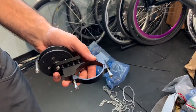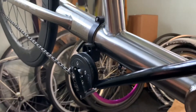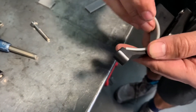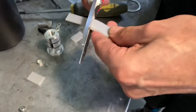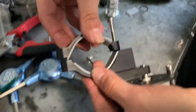Here's how to do the chain on your Mystique. It comes with a Terra Cycle idler that goes down here. When installing, you undo these two and first cut these to length — you need one on each side. I'm cutting right here, and then the same length on the other side. They don't have to be exact; no one makes a 58mm, so this is actually a 60mm, one piece on each side.